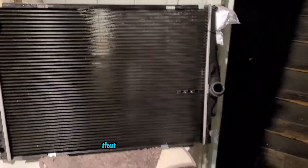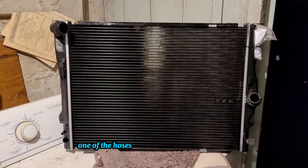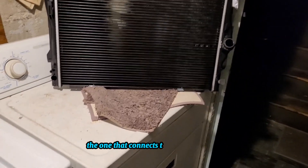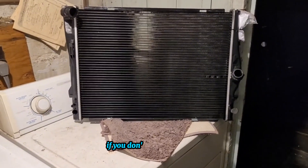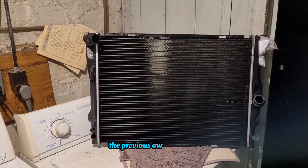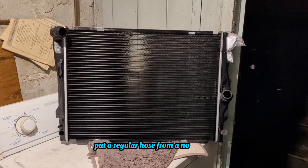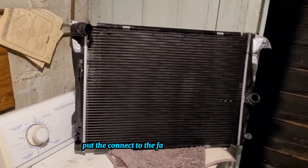There are other ways to tell if you have a SULEV as well. One of the hoses that runs down here has a port for a sensor — that sensor connects to the radiator fan. If you have that sensor, it's a SULEV; if you don't, it's a non-SULEV. On one of my other cars, the previous owner had put a regular hose from a non-SULEV, so the radiator fan wasn't kicking in. Once I switched it to the correct SULEV hose with the sensor and connected the fan, it worked fine.